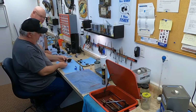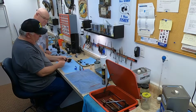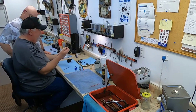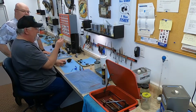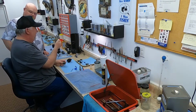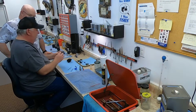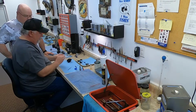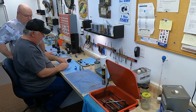Make sure that your thumb is holding tightly on one side so that it can't fly out. Then click in, lift one side out, and then pull that clip out. If you don't do that right, it's going to fly across the room and disappear, which is why you should probably do it while you're holding it in a plastic bag. Then this pick has a little tip bit on it. You can do the same with a paper clip or a pair of pliers, just bend it over just like that, stick it in the middle, and hook that bearing and pull it out. And here is your other tension disc inside there, which can be a little tricky to get to sometimes. It's pretty tight. There, get it lifted up and out.